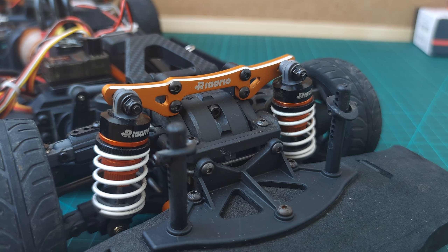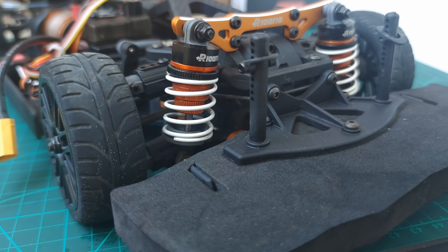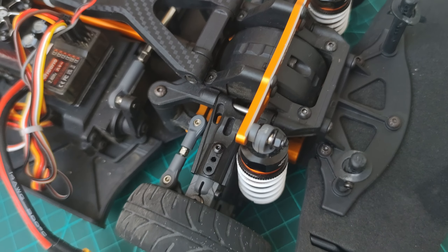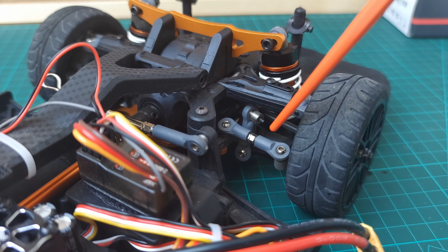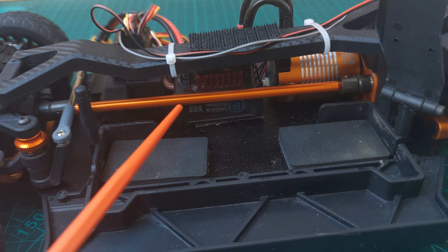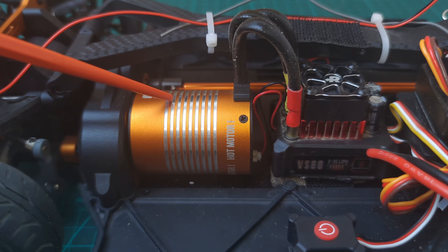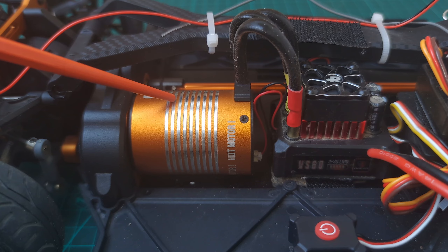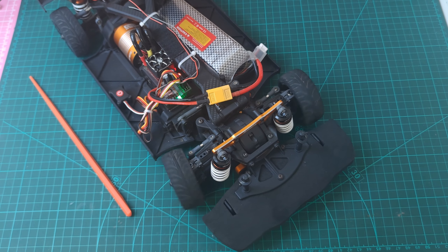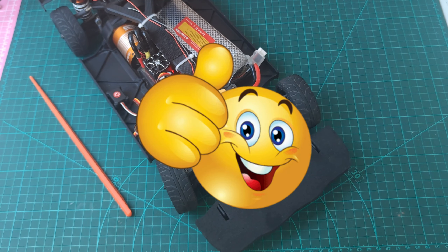Front and rear shock towers are anodized metal with some really nice beveling. Shocks are metal, adjustable, and oil filled. You've got double wishbone suspension front and rear. You can set the camber to three different settings using this screw, and toe in and toe out at the front and rear is adjustable using these links. The center drive shaft is metal — on this version it's all one piece, while the carbon fiber version has a center support and is split into two parts. The motor on this version is a 3650 4300kV, ESC is 60 amp with a temperature sensor, and it has a good steering servo with decent reaction speed. There was an issue with early YouTuber versions rubbing on the drive shaft, but those have been fixed now.